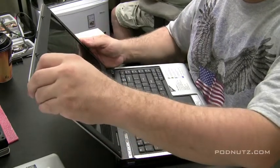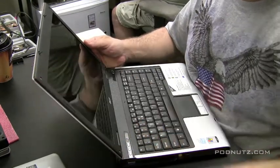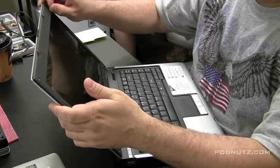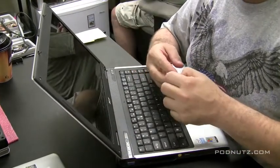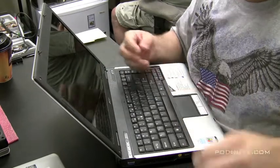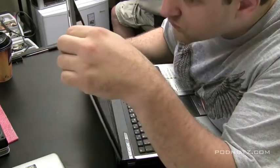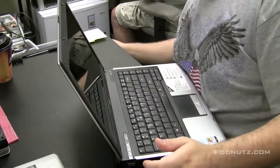What I'm doing is pulling out the little rubber pieces on the screen — that's where the screws are hidden behind, and that's how you get the screen out. Pull out those rubber pieces. Some of the rubber pieces may not have screws behind them, but it's best to check anyway. This Acer has, I believe, four screws holding it in.